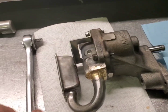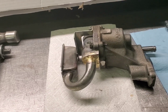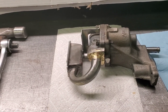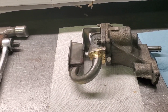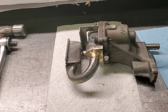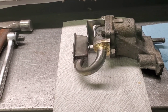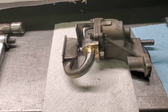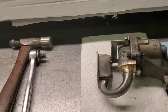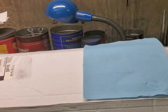Hello guys, we're back at the shop. Here's something I hadn't done before — some of you veterans probably know about brazing old school the oil pickup tube. A lot of times on these bolt-on ones, if they drive into the pump pretty good and they seal, we don't braze them up. But this particular one fit rather loose, so I wish I would have showed it before I did it.